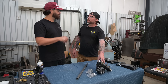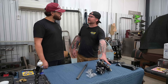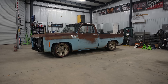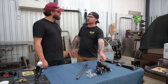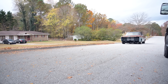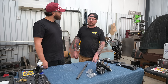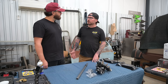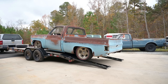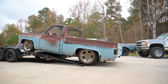These are a direct bolt-on for '68 or '69 to '87. You can also get these for the '60 to '66, or '60 to '67 truck — '67 because that had a different frame for the power steering. On your truck we're using their quick ratio box. This is a fixed ratio, 12.7 to one steering — a more sporty, car-like steering feel. We've probably sold 40 or 50 of these boxes over the past few years. None have been returned, no complaints ever. It's a good steering box at a good price point.